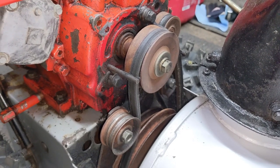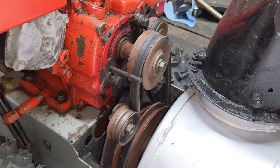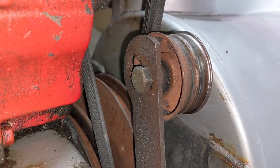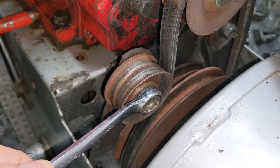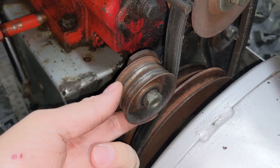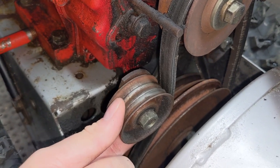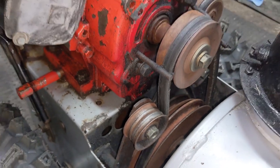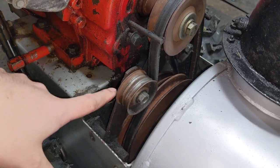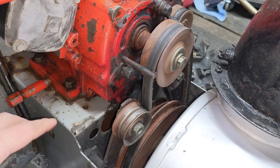In the case of this snowblower, it's an old belt that is stretched and the idler pulley was adjusted all the way in. But if you're noticing that your snowblower just isn't throwing snow like it used to, and you come down to the idler pulley and see that it's on the outside of that slot, then it's going to be quite simple to make that adjustment. On this particular snowblower it has a 9/16ths bolt and nut. So go ahead and loosen that off using a wrench, which will allow you to make your adjustment. A lot of times you're not going to have to go all the way in — sometimes you can just go in a little bit. Snug up that bolt and nut, and then pull over your recoil with the idler in the disengaged position to make sure the pulley spins without grabbing the belt. You might have to play around with it to find that sweet spot.